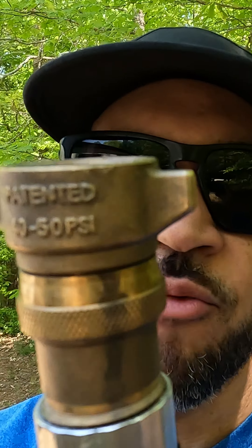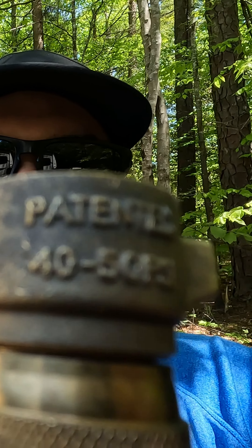Lastly, make sure you have a water regulator, because not all campgrounds are created equal with water pressure — all cities and campground wells have different pressure settings. This one ranges from 40 to 50 PSI, which won't hurt your RV plumbing and is within specs to protect your PVC or whatever plumbing you might have in your rig. I hope that was helpful.